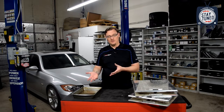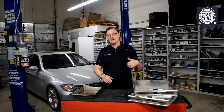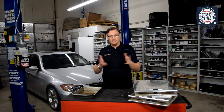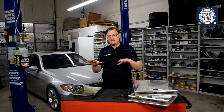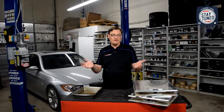So basically what happened with this car was before we bolted the struts on, we gave it an eyeball approximation, bolted everything on, put it down on the ground for the first time and saw that the front suspension was about an inch and a half too high and the rear suspension was about a half an inch too low. As we brought the car up and were correcting the front — pulling the front struts down — we were about to jump on the rears and change the ride height there, but we decided to put the car back on the ground first and make sure our rear measurements were correct before tinkering there.